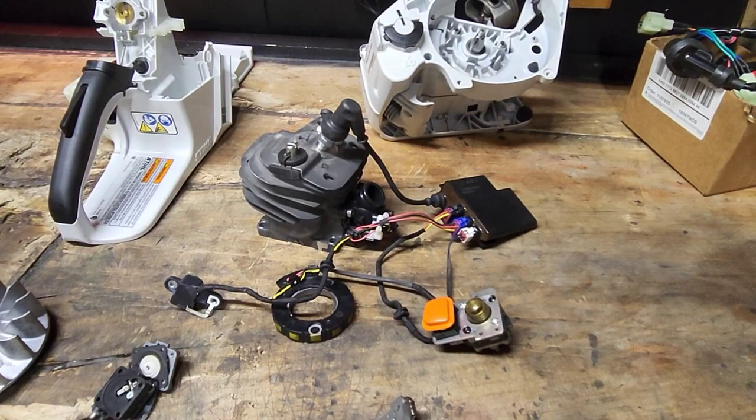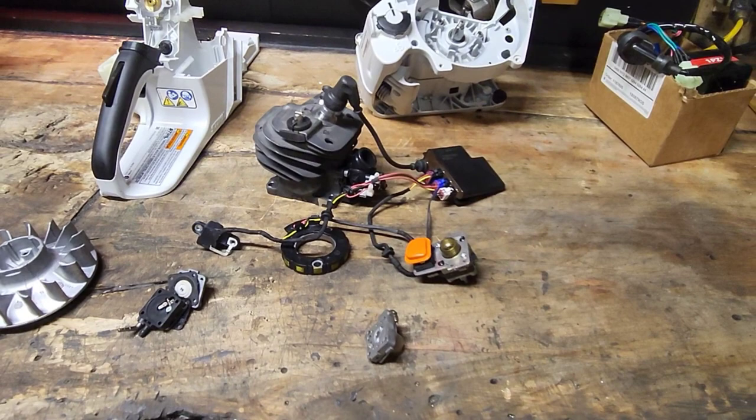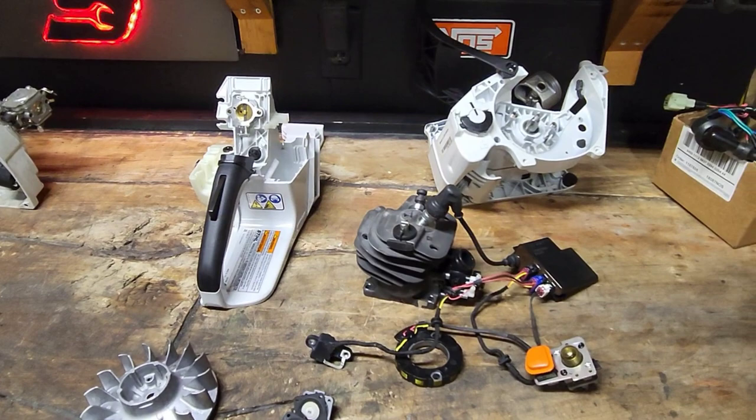I've pretty much come to the conclusion that that's what the issue is. Just let it idle for a little bit. Let the saw calibrate itself for idle a little bit, and then it'll hot start a lot better. Don't use the decomp. Here's another thing with the 500i's.